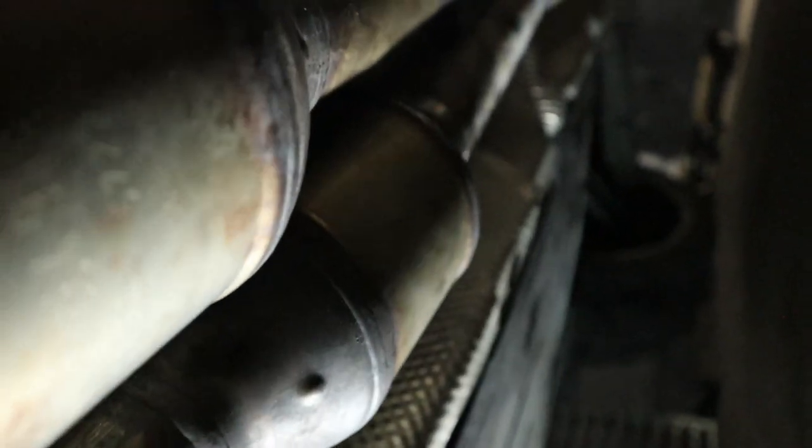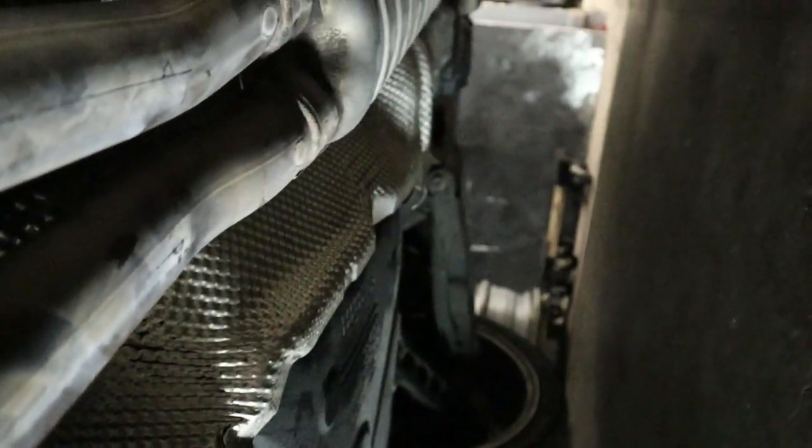So we've got the entire exhaust mocked up right now. You can see full ground clearance, just like the OEM system. And from the front here, I don't have any gaskets installed, but I do have some new hardware holding the secondary pipes to the downpipes. And then right here, we do have the factory bracket that goes to the transmission installed. So it's holding those pipes up and parallel. And then back here, you've got the secondary cats. And then this is our joint, where we've got the 325 exhaust that's gonna match up to the 335.